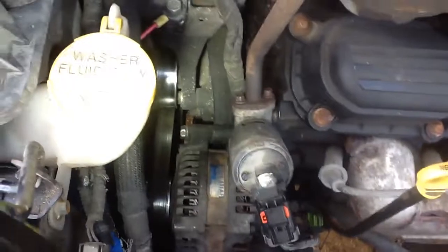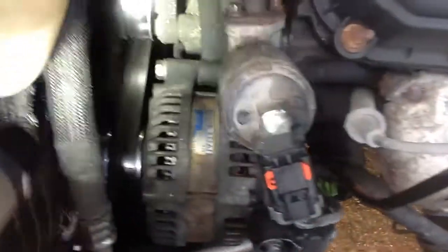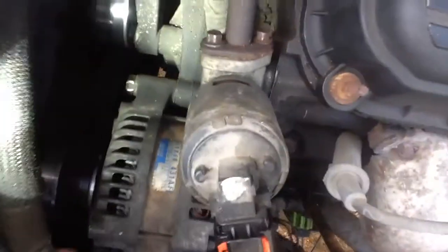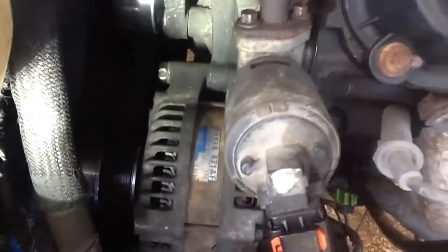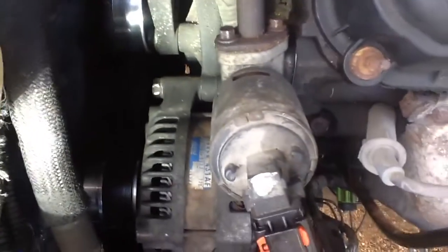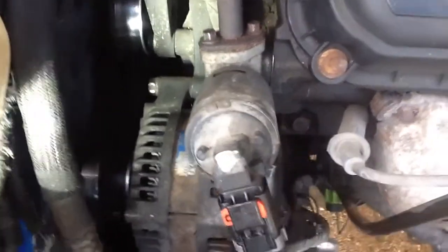And then up in here, the main bolts. There's one right there. There's one down under you get from below. On the one down under, I used a 15mm deep socket. It worked out good as far as fit and everything. These are 15mm up here, both of them.